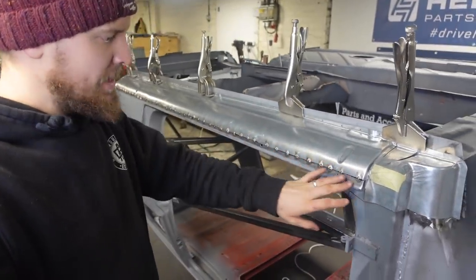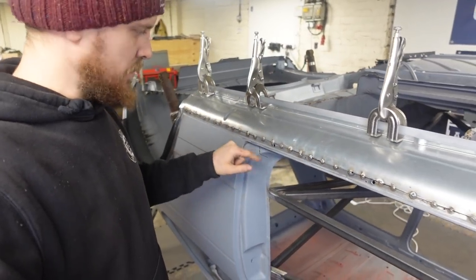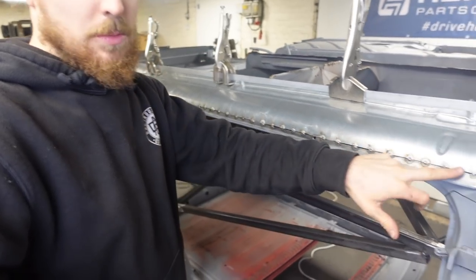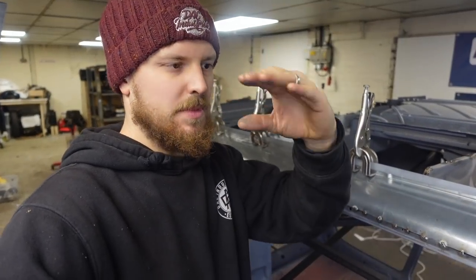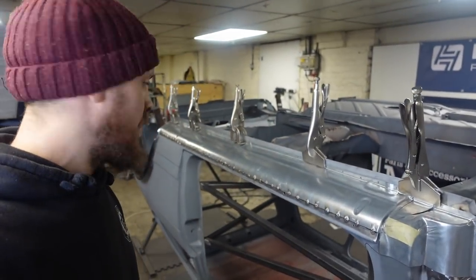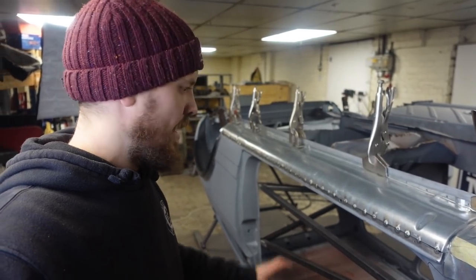And there's that sill, tacked on, in place, feeling nice and flush all the way along. It's a bit wobbly where I've cut it, but it feels awesome. It's gone a little bit tight in areas, so I'll weld the bits with gaps first, then go in with the grinder and just release a little bit of pressure where it's close. Because if I go welding where the metal's basically touching, as the weld cools it pulls the metal together and will create a point on the weld. That technique is brilliant and it's worked pretty damn well — I'm well happy with that. It's starting to look like a car again.